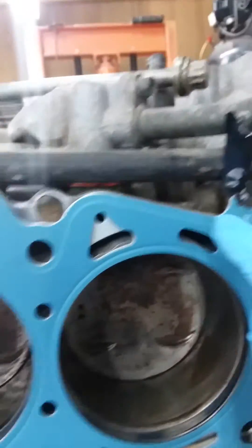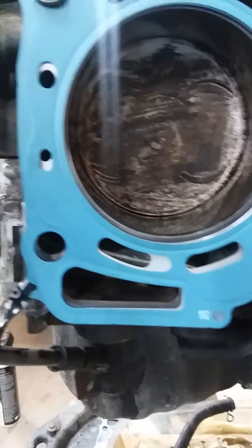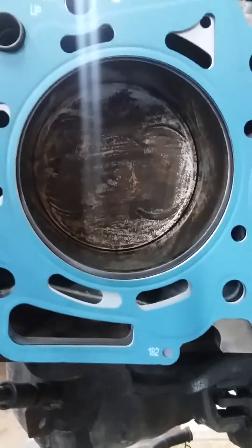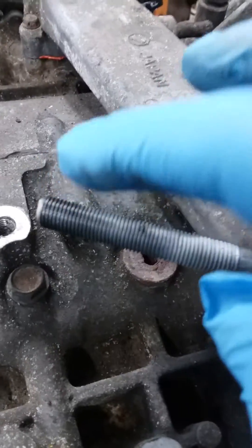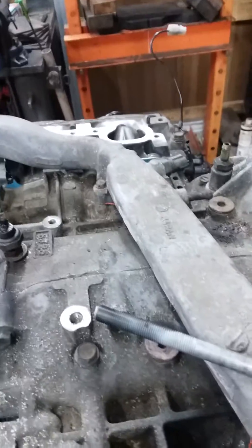Head gasket first, I'm going to show you all a few things. I removed these little tiny copper grommets and put electrical tape back in place just so it'd stay on there and not fall off. Everything still lines up — been doing this for a while, ain't no issues with it. But you don't want to leave in those grommets because it bends the head gasket and can cause problems later. Also, you want to take a little bit of oil, put it on the inside, just run it around the inside. You want to make sure your head bolts are clean — put a little dab of oil on the end so it runs in better.